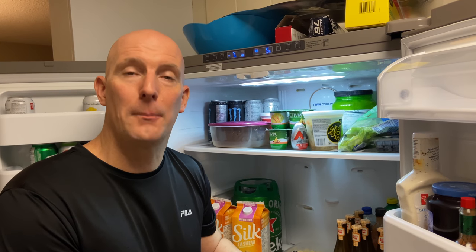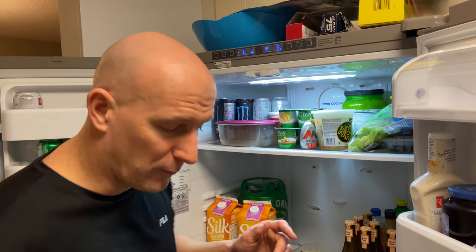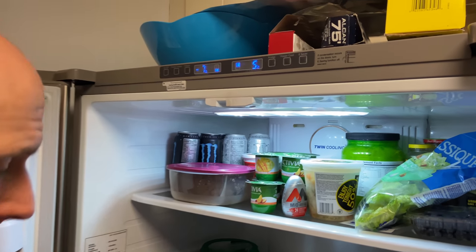That's what's actually happening — there's ice in the drain plug. You're also going to have to check to make sure that your drain is free and clear of dirt and not backing up any water trying to go down. I'm going to show you how to do the power defrost on the fridge and I'll also leave that in the video description.